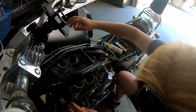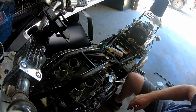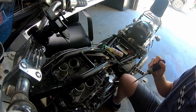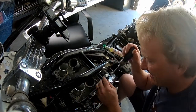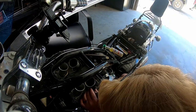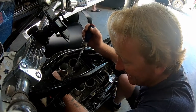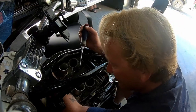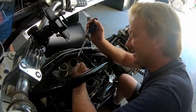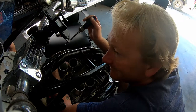We got all the screws in but when it comes to moving these little metal flanges into place, do it slowly so that you don't heat them up — they will break easily. You don't want them to get hot and weak. That's the primary deal. Typically when you're doing a carb job, these are parts you're going to want to put new ones on just in case they have been worked on. It's like any situation where you have to bend metal — the more you do it, the weaker it's going to get. They're not very expensive, so to replace them on the forefront is not a bad idea.